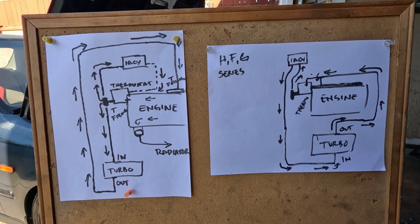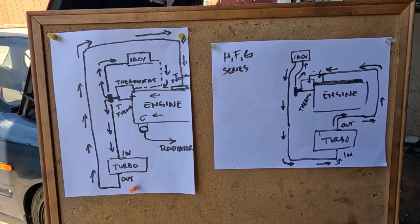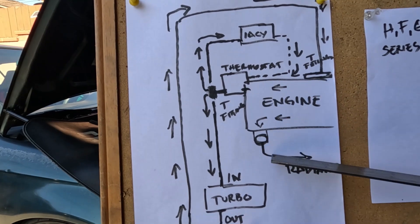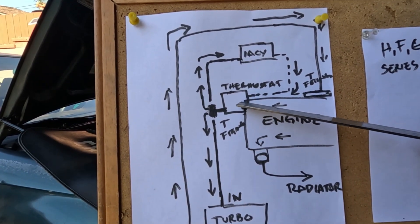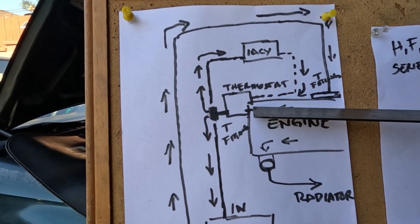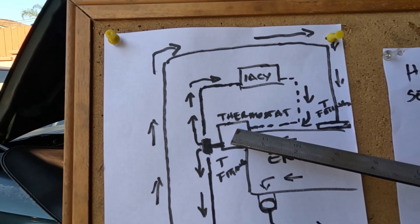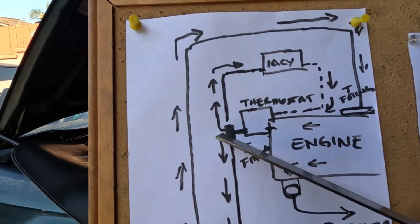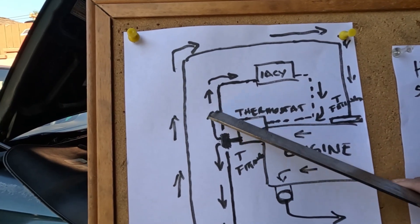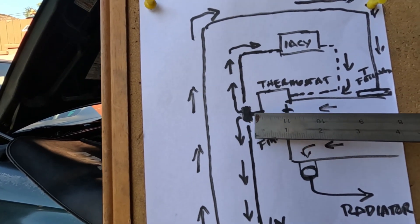Just a reminder — this is just an idea for running water coolant to cool the turbo and reduce its temperature, but always do your research. The H22 has a thermostat with a fitting for the IACV. The water pump pumps water out to the IACV, then it goes back to the cold side of the thermostat housing and repeats the cycle. When the motor shuts down, it does that siphoning effect — that's the goal. To make this work, we need to tap in by installing a T-fitting.